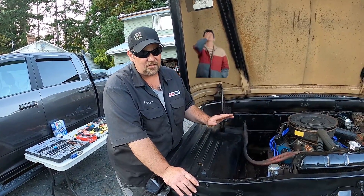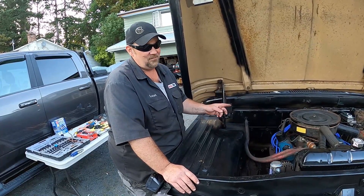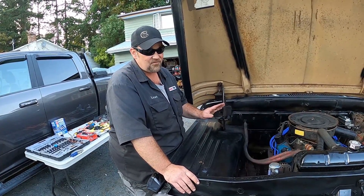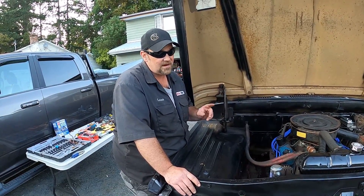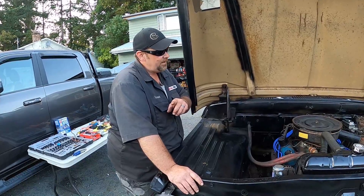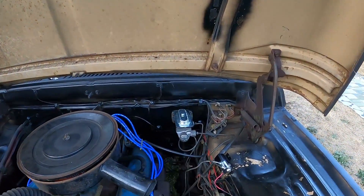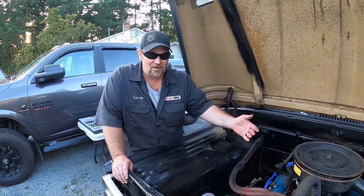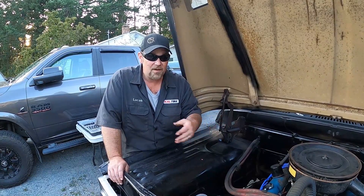That's it for the tune-up. We were slightly hit by the parts store curse — some of the parts don't fit this truck. We got the right spark plug wires, spark plugs, and rotor, but the cap, points, and condenser weren't for it. That being said, we made the tune-up work. We're also going to be taking the 383 out of my old sweptline Betsy and getting it back to Nick's Garage — make sure you check out Nick's Garage on YouTube. We also put in the new master cylinder, and those of you in the know will understand what that little solenoid sitting by the master cylinder is for. Thanks for watching — please like, share, subscribe, and we'll see you on the next one.